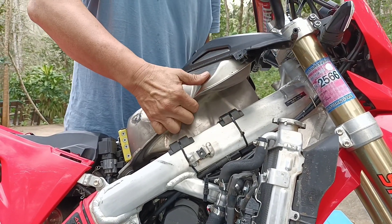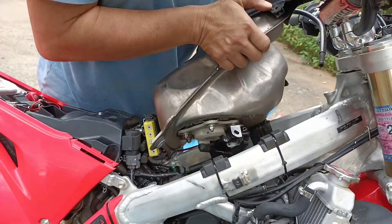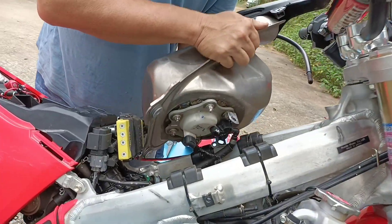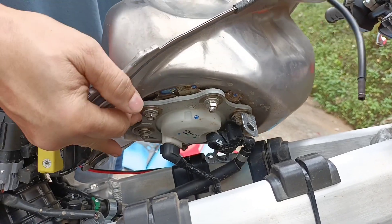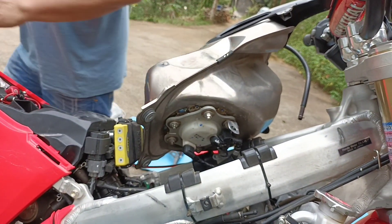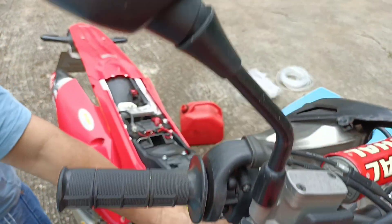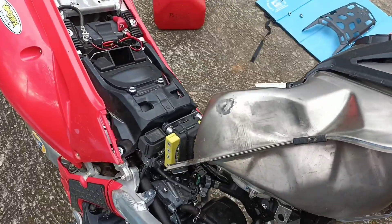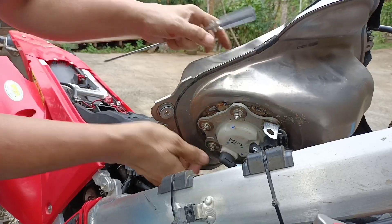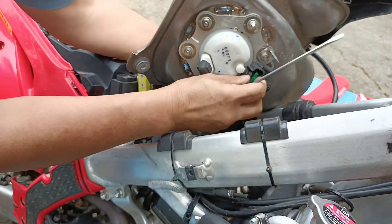Now be really careful as you pull this metal fuel tank off because those edges — you can see where that join is — those edges are really, really sharp metal. So just pulling the tank up and off gently, being very gentle, because you need to remove the fuel line and the sensor connector. There's no magic to this — the sensor is just a normal electrical plug, so hold in those tabs and ease it off gently. The fuel line has a special little green clip that you need to unclip.